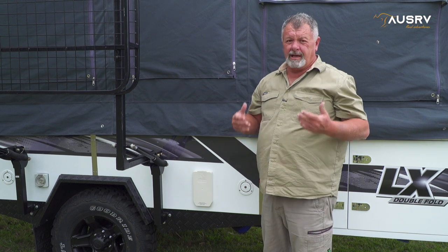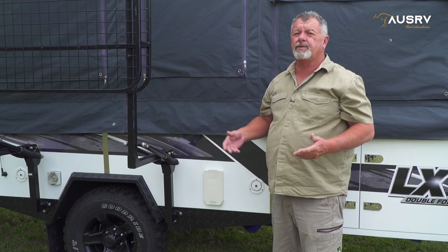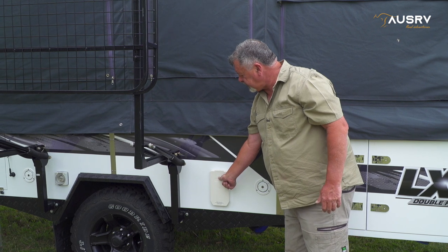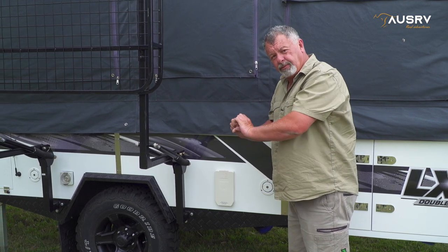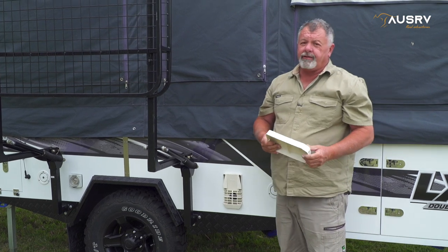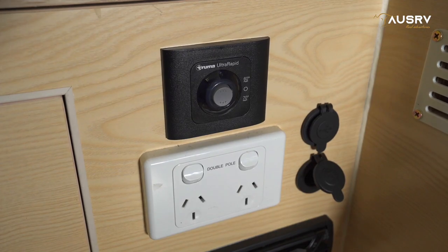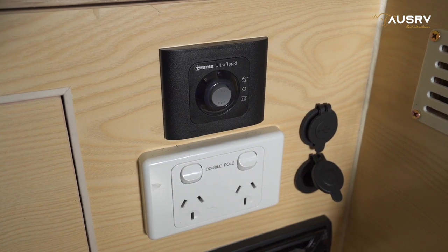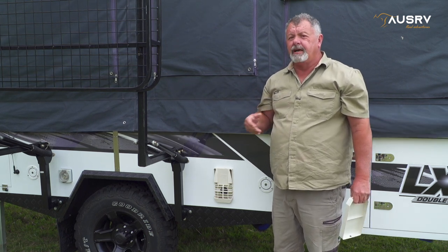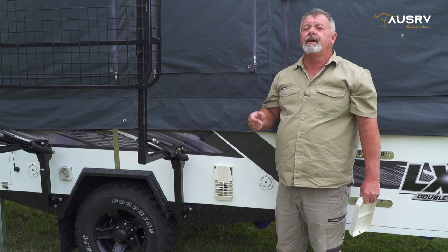Before you turn on your hot water system you need to come out to the side of the camper and remove this cover. If you're doing it for the first time you also need to purge the water through the hot water system and make sure there's no air in the lines. To remove the cover, place your thumbs on the centre, apply pressure and pull the cover from the top to release it. Now you can go inside and switch on the system, make sure it's turned on at the main board. Then it's simply a rocker switch — up for 60 degrees, down for 70 degrees. When you use it for the first time there is a lot of air in the gas line which will need to be purged out, so it's a good idea to run the kitchen first and purge as much air out as you can that way, then click your hot water system on.